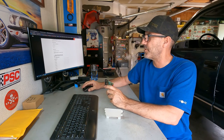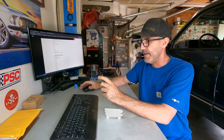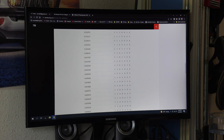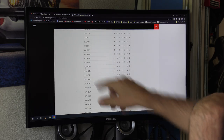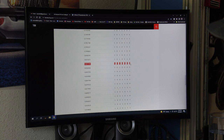Here's where we have to make an educated guess, since the chart has seven positions but we have only six adjustable jumpers. Typically I'd just solder one myself, but I like the versatility of being able to adjust it — in case I go to 37s. Our number is 0.83098. Scrolling down the chart, I can see 0.836 and then 0.827, so we're going to be right in here. Double-checking our number — 0.8309 — we're actually closer to 0.827, so we'll use that dip switch setting.